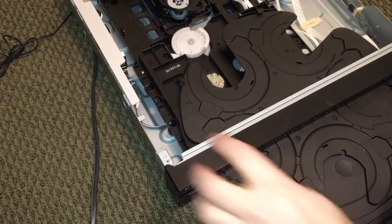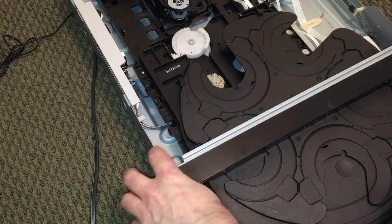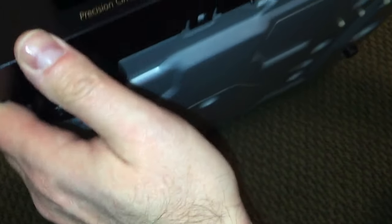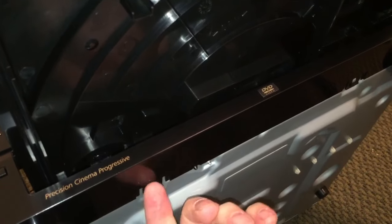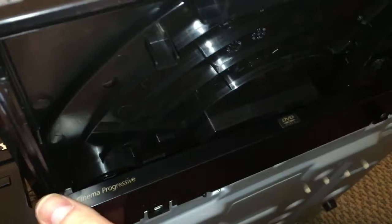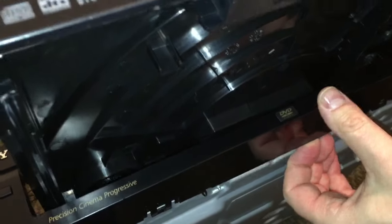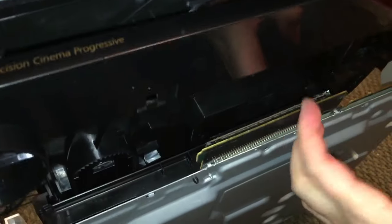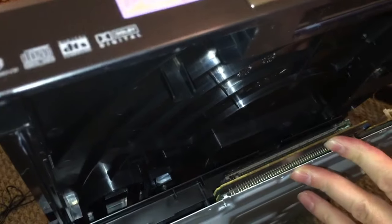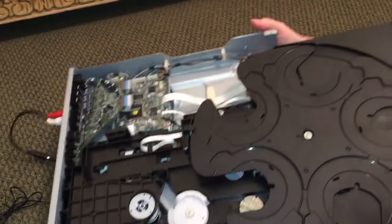There's a little tab here and a tab here — again, I've removed those screws — and on the bottom are some tabs as well. There's a tab here and one over here. So I'm going to pull those up and pull this bezel off very carefully. I got that ribbon cable off of there, so now I can pull this whole thing off of here and set it down.